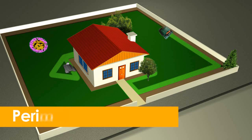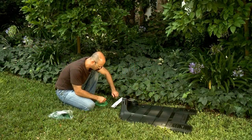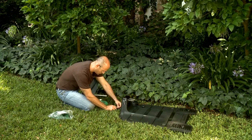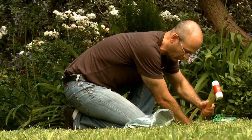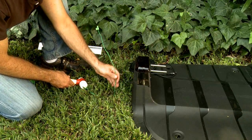It is now time to set up the perimeter wire around your lawn. The wire will define the designated mowing area and guide RoboMow when mowing the edge. Starting at the base station location, pull the wire ends with the plot connector out of the plastic covering. Peg the beginning of the wire to the ground where the base station will be located. Be sure to leave enough wire to close the loop at the end of the setup.